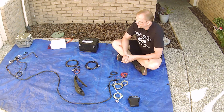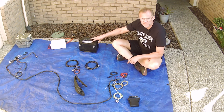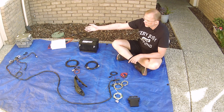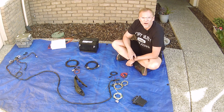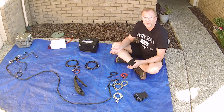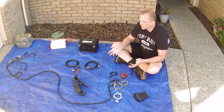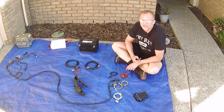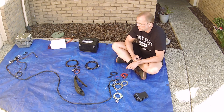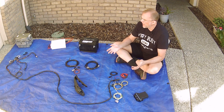We have quite a few components here, but this is just a regular car battery — a key component. Even in an electric vehicle, we still use a regular 12-volt car battery. It powers the inverter, the controller, the throttle pedal, and the neutral safety switch on our transmission. The biggest challenge when doing an EV conversion and borrowing components from an electric vehicle is making them work outside of that vehicle. In our case, we've taken an inverter and transmission from a Lexus GS450H and basically cut the head off of it — so how do we control the vehicle?